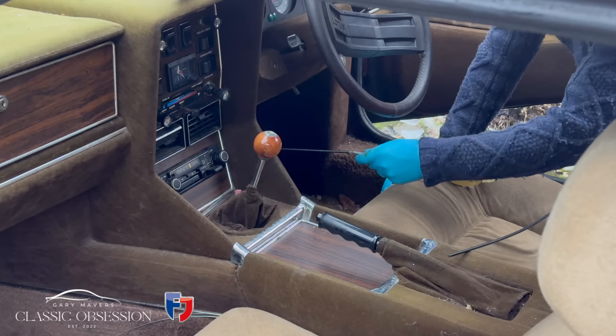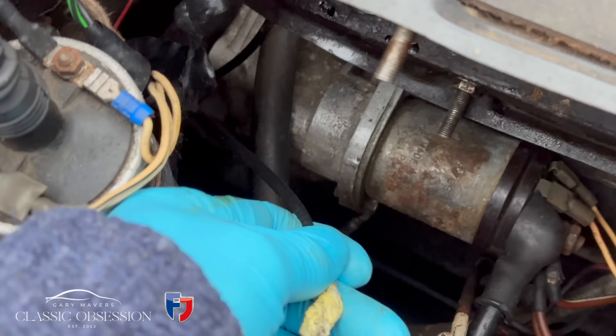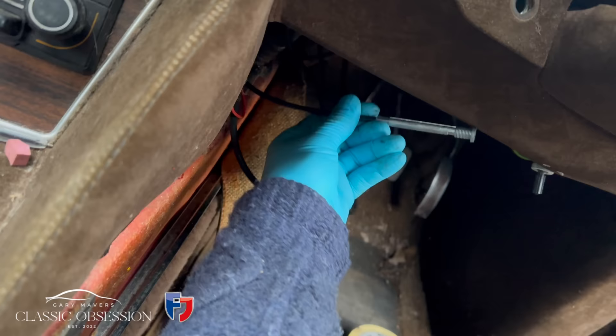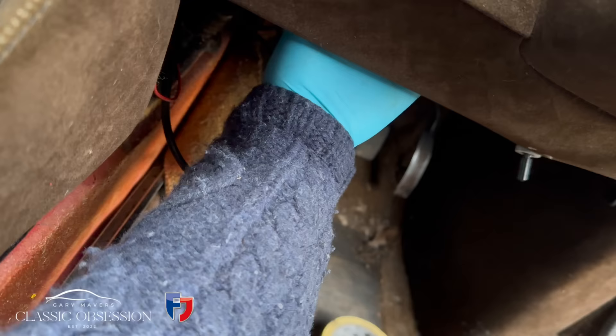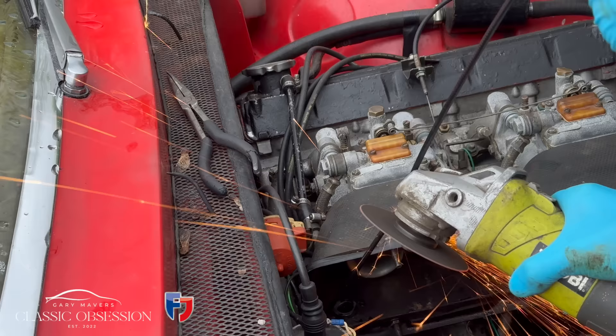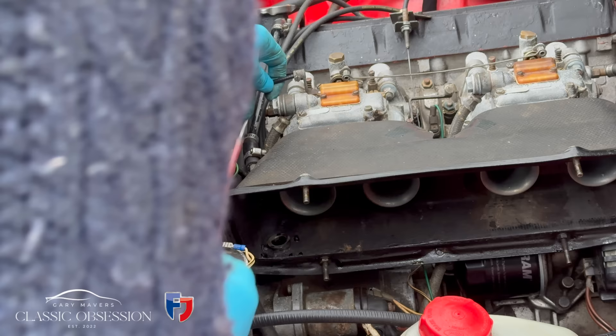See this little chrome bezel? Let's feed the wire back out. I'm going to fit the brand new sheath, tape it up carefully, attach it to the old one, and carefully feed it through. Pull it out into the engine bay. See this cone — this is the new cone. The thread's on the inside, which means the chrome bezel that finishes it off and attaches to the dash won't be able to screw on. So back to the drawing board. I'm going to have to drill the original cone out so it's a little bit bigger, then refit that.